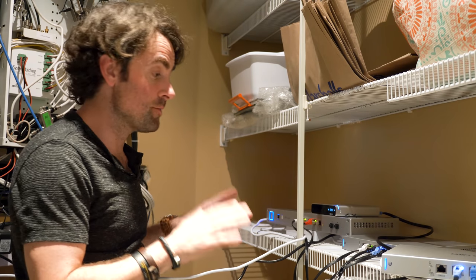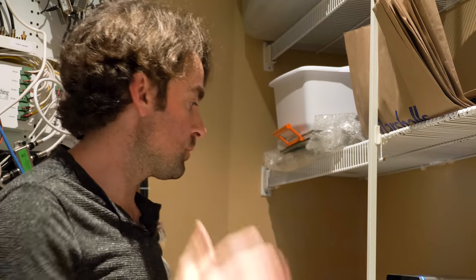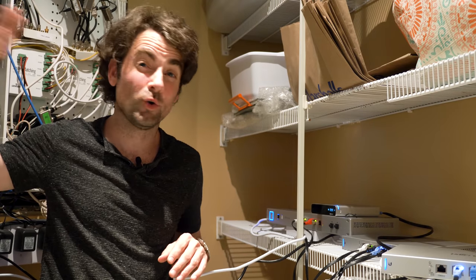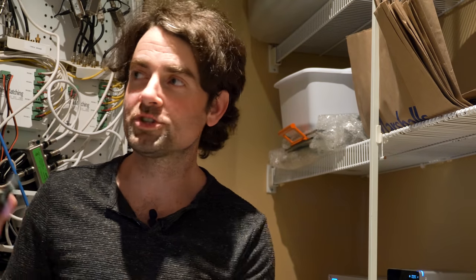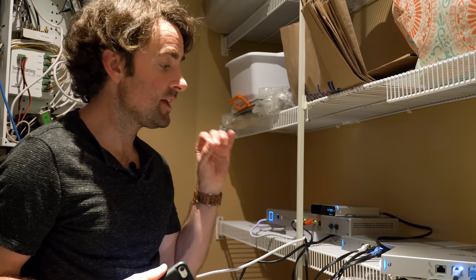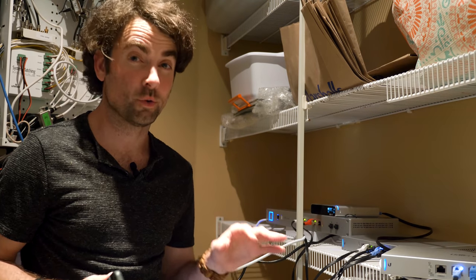I'm going to make this setup nicer in a minute. We've got 10 gigabit running to the computer downstairs, and my thought process now is we need to prioritize which connections should be 10 gigabit and which ones we can do with just the old system running at 100 megabits per second. In an ideal world, we would just remove these old crappy switches and put in brand new Ubiquiti switches, but we don't have 48 10 gigabit connections. So every jack we're going to be using will have 10 gigabits, but the rest of the house will still be connected even though it'll be much slower.